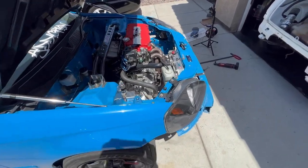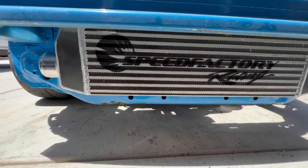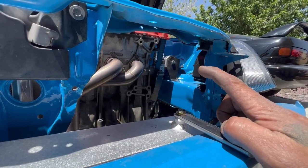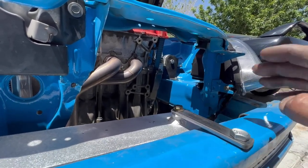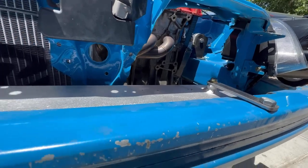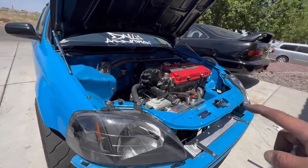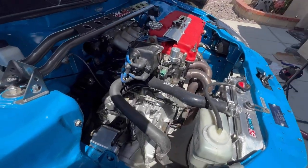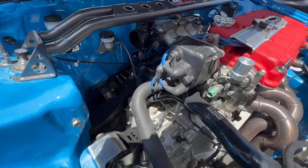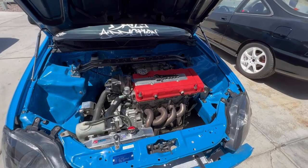This is the Speed Factory 500 horsepower intercooler — two and a half inch — with M8 by 1.25s here and M10 by 1.5s for the mounting. Got that mounted up. Right now we're going to put the couplers on, then get up into this area and figure out where to put the blow-off valve, weld that up, and then get it to the throttle body. That'll be the cold side 100% done.